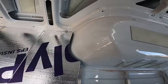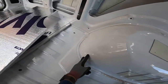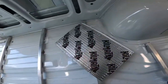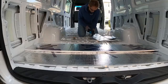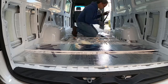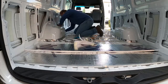Looking at the base of the wheel well, the foam insulation covers three-quarters of an inch of it, and each subsequent layer will cover more. I'll end up with about an inch to an inch and a half of untreated wheel well — meaning not covered with kill mat, which is really important. So I'm going to do a couple of strips of kill mat on the base of the wheel well quickly, so we're not leaving any opportunities for sound dampening unexploited.